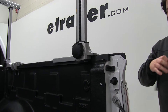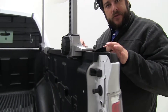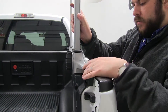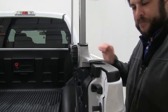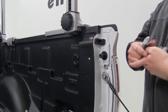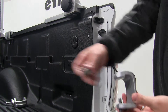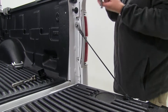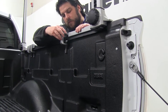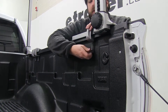Let's go ahead and show you a couple of things here. They come with these pads, which you put underneath the feet so it will protect your truck bed or your bed liner so they won't scratch it up. Then we'll take our first clamp — it has this pad here which will go underneath the truck bed — go ahead and put that in position, just slide it on down, then tighten it down.